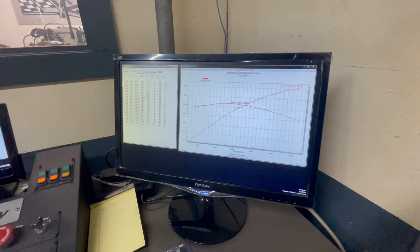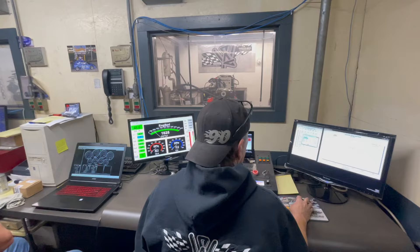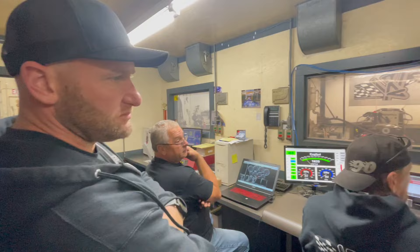It's pretty much exactly the same. They're just running it to 6,600 RPM — just where GM has these things rated. So if we were to change the cam and lifters, what would you run it to then? Cams, springs, lifters, and possibly valves — most likely just springs and whatnot — and then we'd run it up to like 73, 75 is usually what we can run them up to. It gave us a little bit mid-range, but it all met up at the big end.